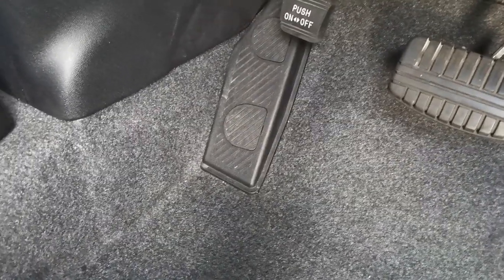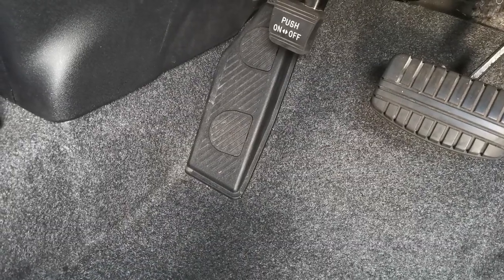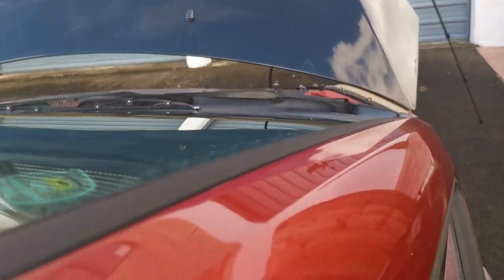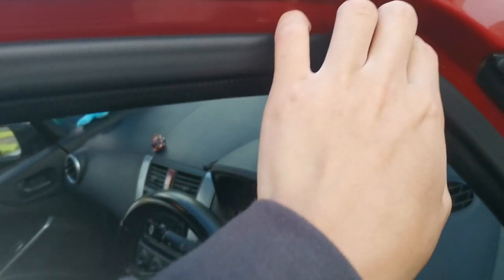I've already tried to fix the issue because there's a rubber grommet in the middle of the floor pan here and up here, if you take this carpet off. But I've already sealed those off with flex tape and it's still leaking through. So the only things I have left that could leak in here are either the AC drain plug, or if I take the front cowl off over there. I've already ruled out the door seals, because I've used the hose and hosed it off and no water gets in. So that's all I have to go off of.